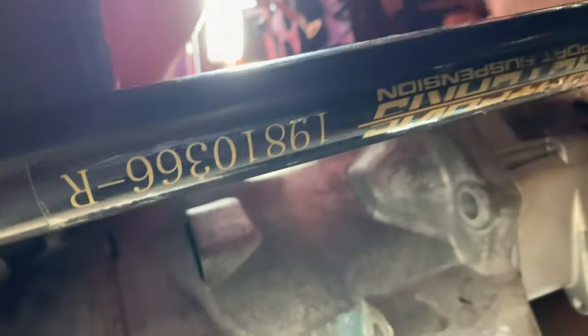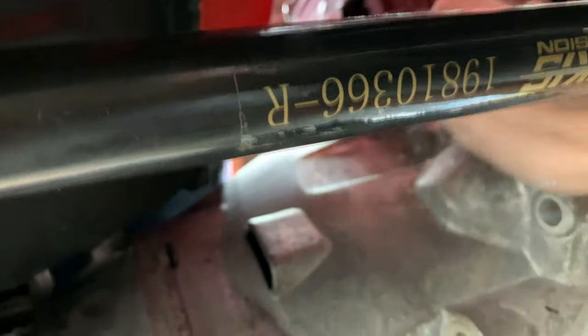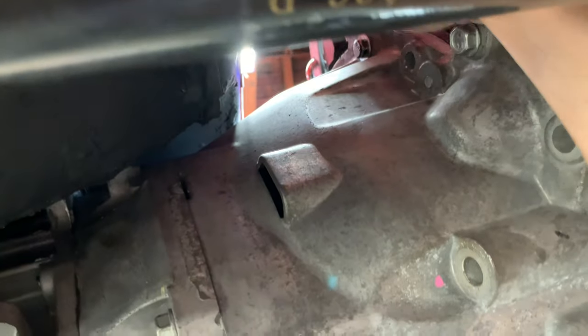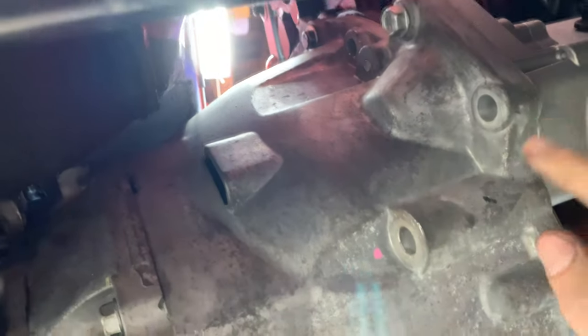And the reality is here that the headers do just kind of pack in this whole area here. I mean, the top tube starts right here, so the pipe's going to come down right here, and that's going to be a pretty close little cut in if I'm trying to run the battery cable back here. I'm trying to think of maybe if I run it down here, but I also don't want it to be in any place that it could get hit by anything coming in from the road. And also, the header pipes, of course, are very, very hot, so I'm kind of thinking that maybe this way might be a better route.